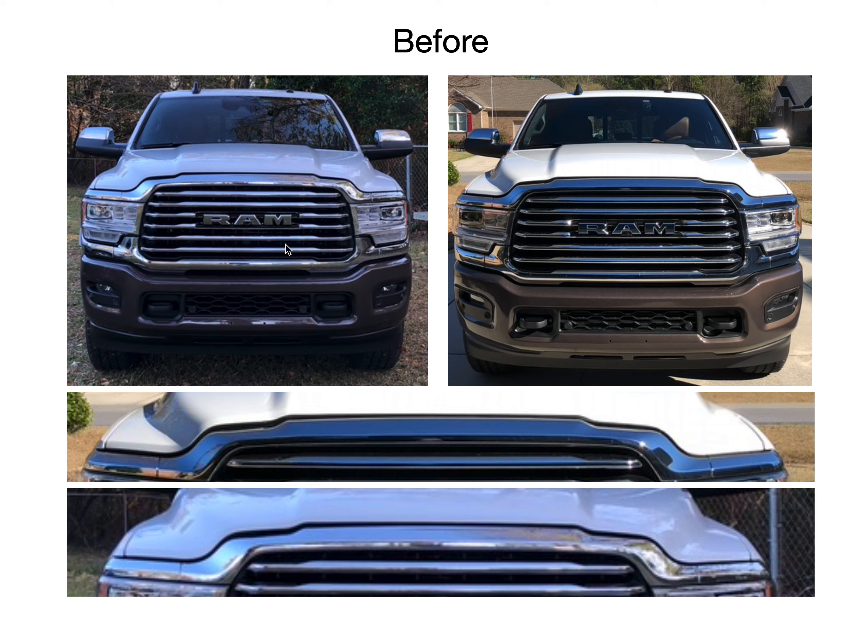You could adjust the hood stops — that didn't work for me. Ultimately, why I came to the decision to move the hood latch was because my hood does not sit evenly on the grille. It doesn't seal evenly. On the driver's side it's very tight, but as you move towards the passenger side it begins to go up a little bit. The hood seal weather stripping on the hood and the grille was not touching at all on that side — I could stick my fingers under there with no resistance, and I could see the hood stop. You're not supposed to be able to do that.